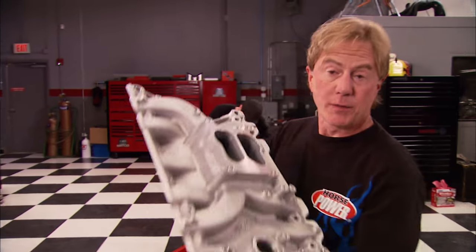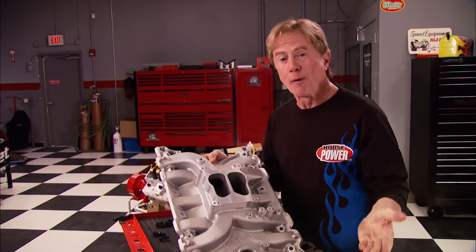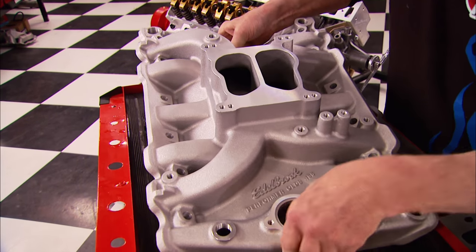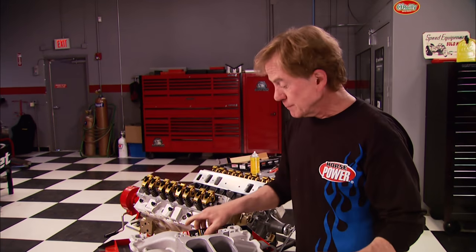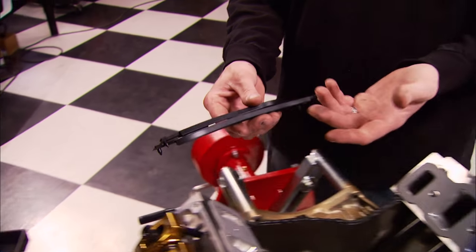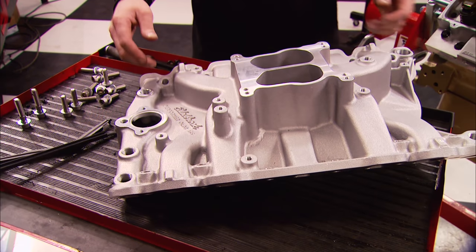We're back with our Olds build and now with this aluminum intake. I remember back in the 70s when the 455 was in its heyday all I had aluminum was the foil on my TV rabbit ears. This Edelbrock Performer is a vast improvement over the cast iron original — it's a dual plane, low rise design made to give you plenty of torque over a broad power range and plenty of throttle response from off idle to 5,500 RPM. They recommend a quarter-inch bead of silicone to make the seal because rubber and cork gaskets can get oil soaked and crankcase pressure from the engine will push the seals out from under the intake manifold, causing end seal slippage.